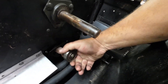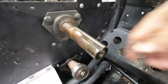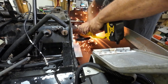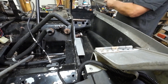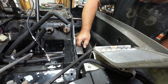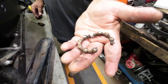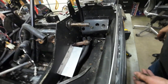First really bad thing we found, other than the gas tank and the motor. That bearing's bad — looks like rust coming out of it, rust-colored grease. We're just going to cut that off. Look at how rusty it is — don't touch it. Pretty rusty, pretty crusty, pretty dried up. Needs to be changed; not to be rolling on that roller.